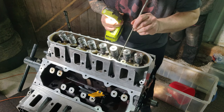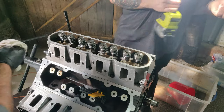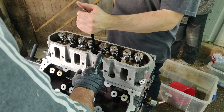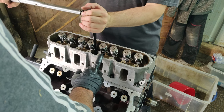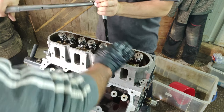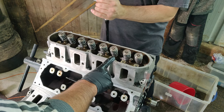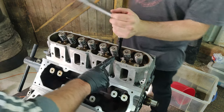At the time we didn't really notice — there are a few holes on the heads — and a washer slipped through onto the back of a valve. Thankfully we didn't have to remove the head to retrieve it. Quite frankly it's amazing it only happened once with the two of us. After all of that, there's a very particular torque sequence for the whole thing. The torque itself isn't very high — it's only around 80 foot-pounds — which is actually less than the OEM head bolts, perhaps due to the ARP hardware's greater clamping force potential.